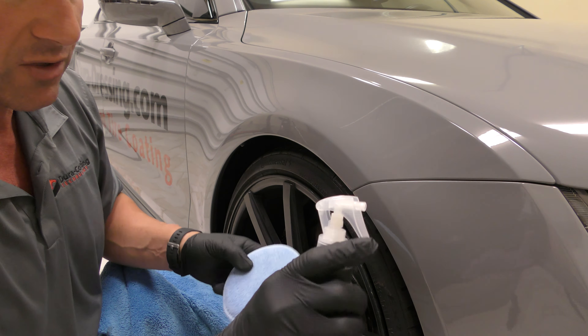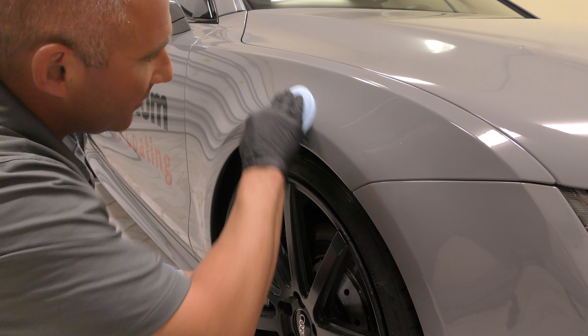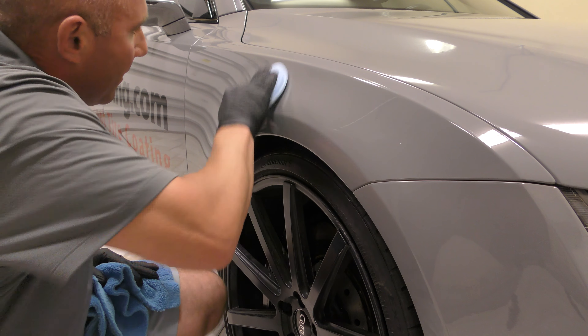It's pretty easy to use. It comes with a little sprayer — you can put a couple squirts onto your pad, that's all you need. When you go ahead and work it around, we recommend you work it in a buffing pattern instead of straight. This does a much better job of leaving no high spots than if you leave it in straight lines — everywhere you stop in straight lines leaves a high spot. This does not.